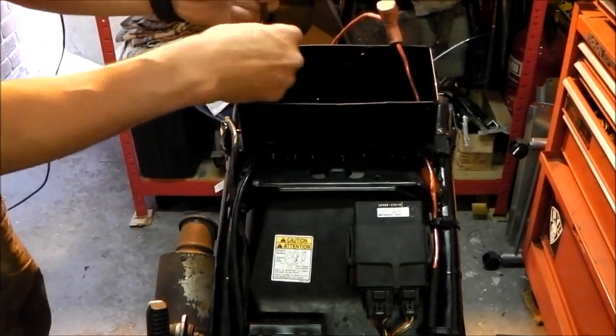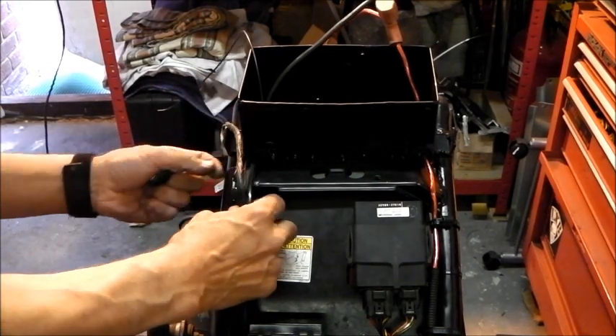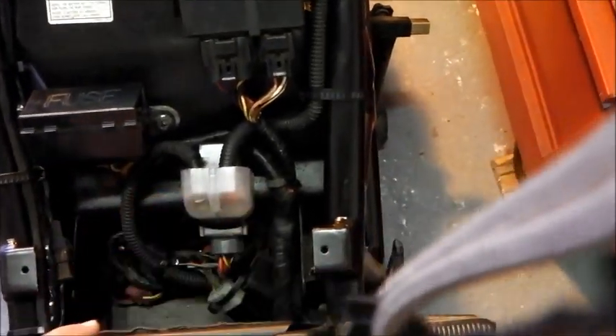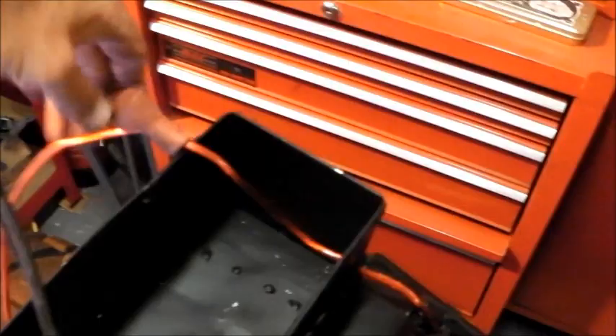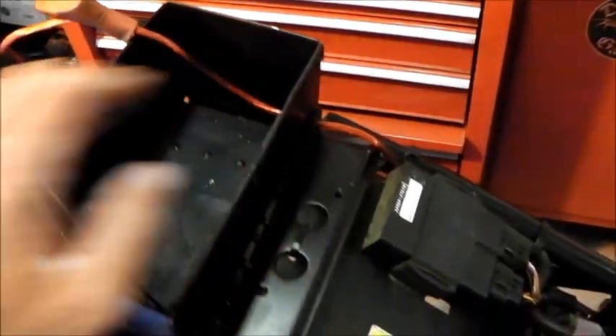Nearly there for this little expedition. As this earth wire was connected - it was spliced in with the battery terminal - I'll push that through there too and it'll take its place next to it. Just some clipping up and we are done for the minute. That is about as tidy down there as it's going to get or needs to be - it's all clipped up and out of the way. I've put that piece of armoured cable there just to run it so it doesn't chafe on anything, and for good insulation from the live to any of these power leads, then run it through a grommet same as the other side. I've got a couple of gold plated ends to go on, but I'm going to wait till the battery's in, then I'm going to finally route them so they're within an inch of slack - a really neat job.